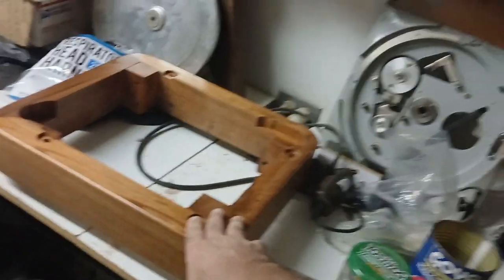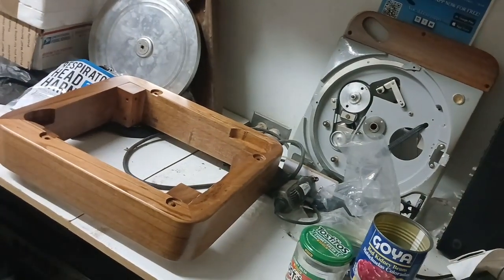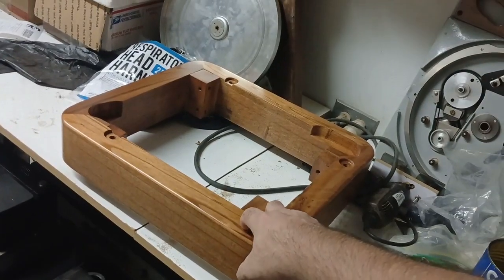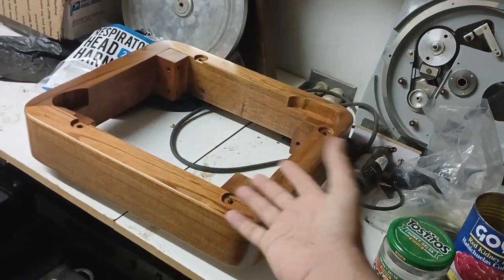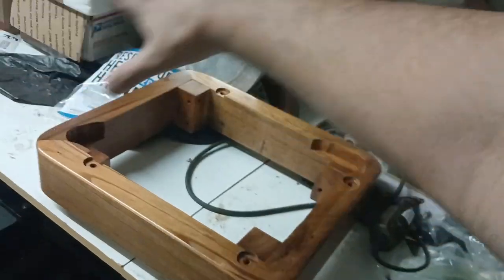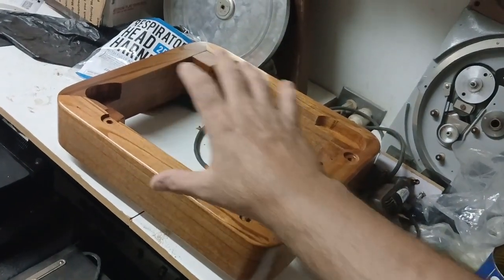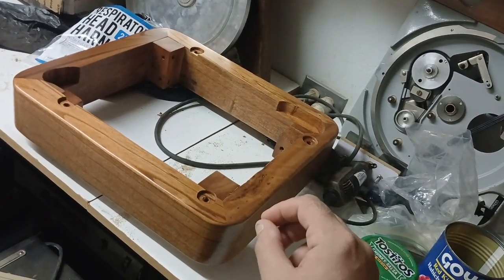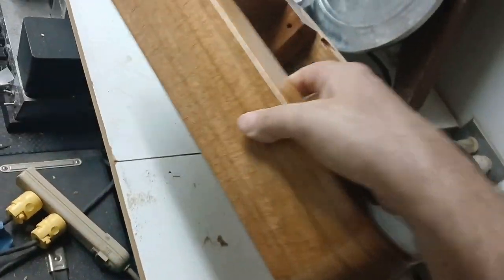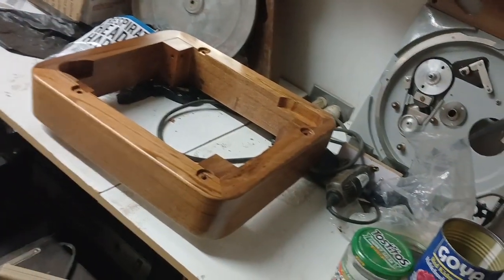This has been drying and curing for about 5 days now, right? And what I did was, over the course of a week, almost every other day, I sprayed heavy coats. I'd do like 2 sessions each day. Let's say before lunch, I'd spray 2 heavy coats on this, let it dry for an hour. After lunch, I would come back, spray 2 more heavy coats, let that dry. And then like 2 days later, I would dry sand any little imperfections that I saw anywhere, any little runs or any little thing, and then give it a general flat sanding on all of these surfaces, right? And I did that every other day. Right now we've had about 8 of those heavy spray sessions, okay, with flat sanding in between.